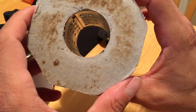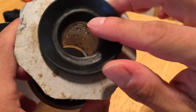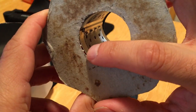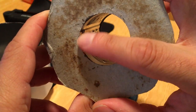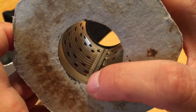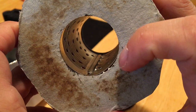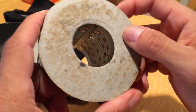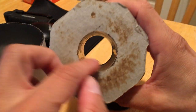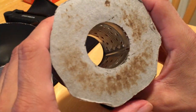One of the issues I noticed right away when I opened this: this is your anti-drain back valve, and right here you can see we have gaps — we have holes. Dirty oil is going to get through there. We have it here too, ever so slightly. That's not good. It should be like the bottom here — you see how it overlaps? That's how this part should be.